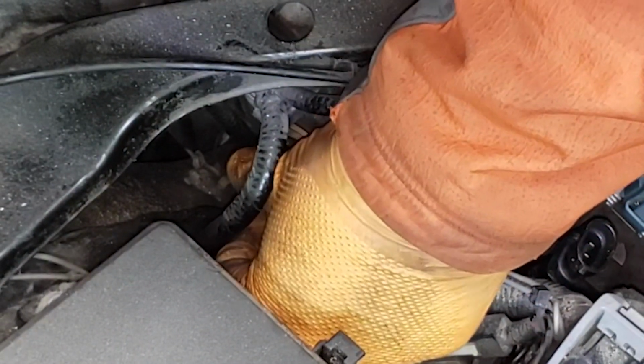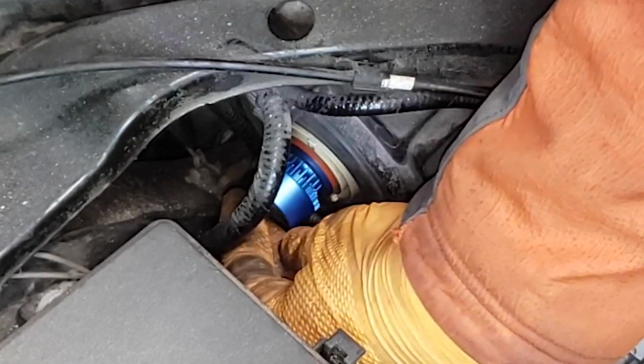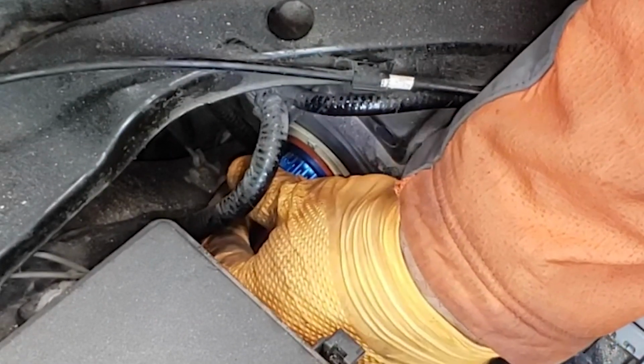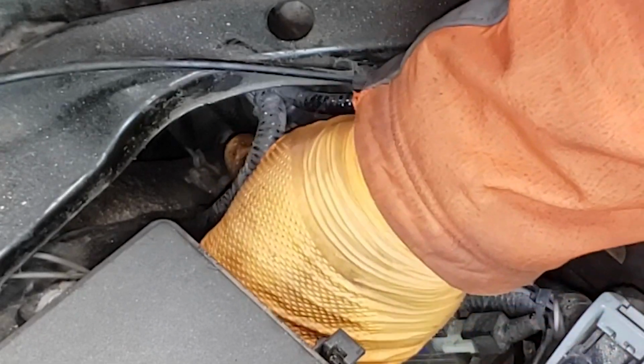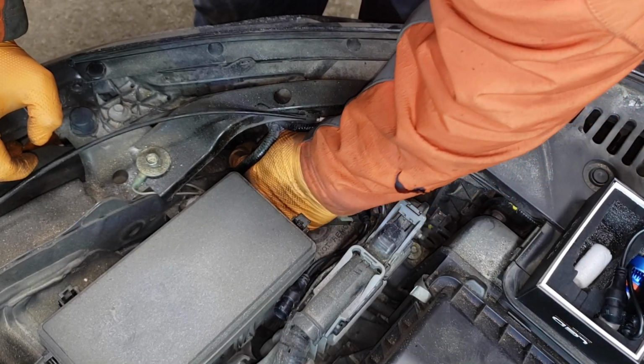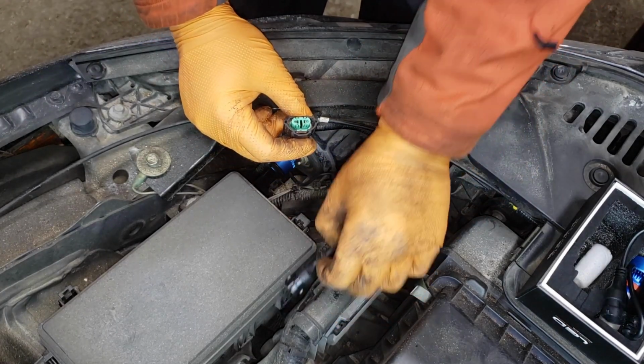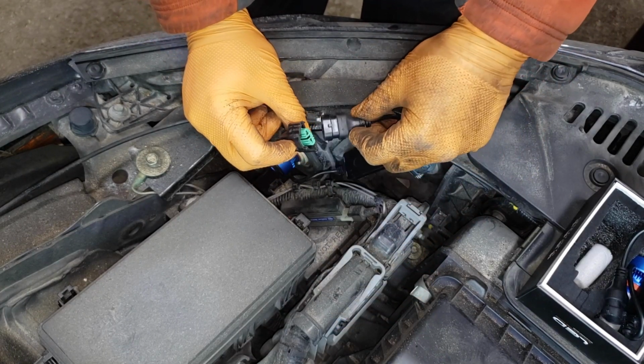With gentle pressure, push it up against the headlight bulb, and then when it sits flat, you can turn it the rest of the way home, ensuring that it's locked into the headlight. Now, get your little connector, that guy there, and connect it to this guy here.